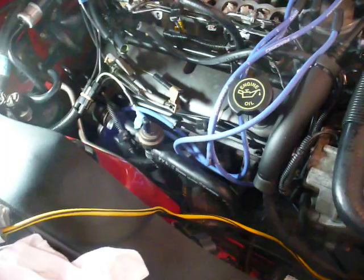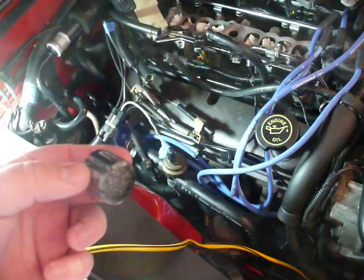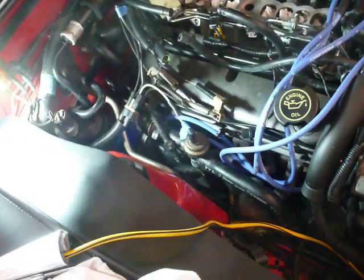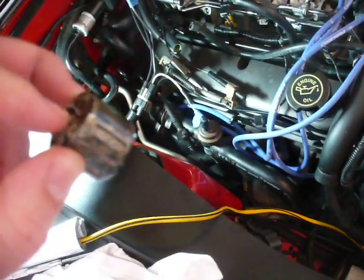But, as luck would have it, while I was reading the instructions on the intake manifold gasket set, they mentioned the breather element, and I was like, well, where's that at? Well, lo and behold, turns out the breather's stuffed down in that same hole, underneath the PCV valve, and it looks like this. It's a little cartridge full of what amounts to, for me, almost like steel wool, just jammed, tucked down in that little orifice, and the PCV valve sits right on top of it.